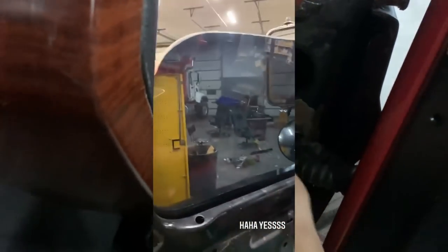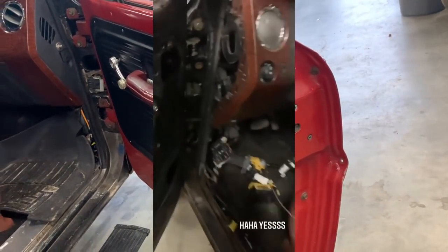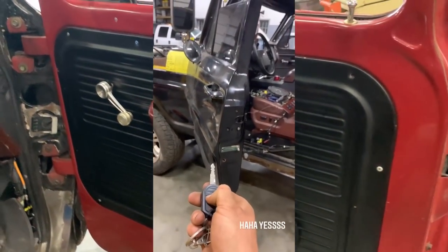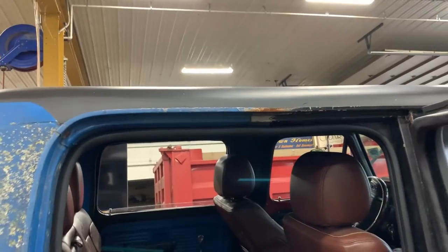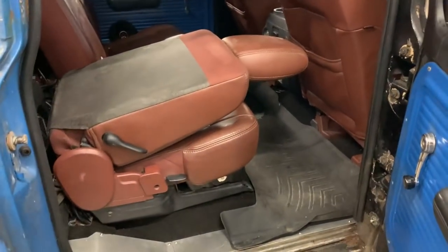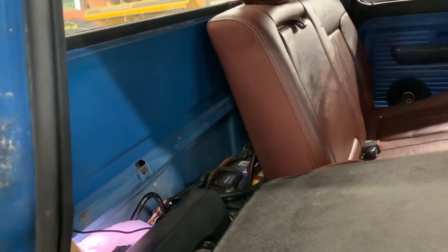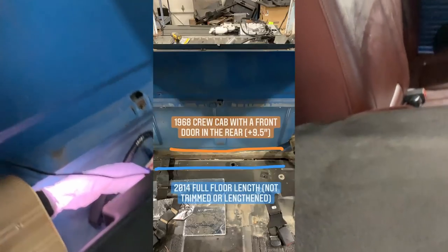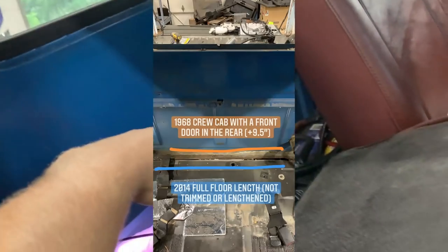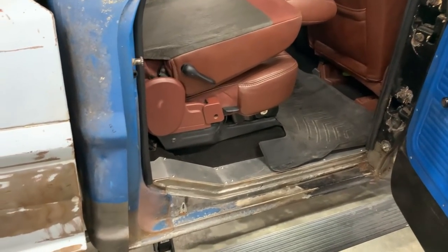The '14 door plugs for all the power is right there — I mounted that with a quick disconnect. Everything works — disconnect it, plug it back in. Right now everything is manual besides the speakers. Eventually I do have the power windows and power locks figured out. To the rear of the cabin, you can see the seam where we cut out of the roof and added the single cab to the rear. The 2014 floor bolts directly to the rear seats. With adding the front door to the rear at about nine and three quarter inches, I actually welded the back of the seam of the '68 directly to the '14 without adding or subtracting anything off the '14 floor.